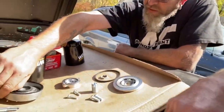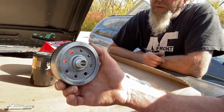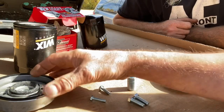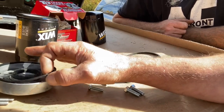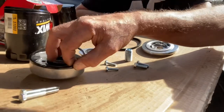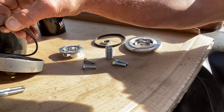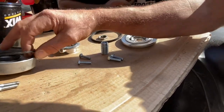As I showed you in the last video, this is the unit we got first - the one that failed. What was going on is this is like some kind of fabric or foam that was actually pushed out. Last time I took it off it was under pressure and it kicked this to the outside. I had actually glued it on to hold it in place - the glue used was pretty wicked. Those are two seriously weak points. We were having an oil pressure issue where we had 40 pounds when we started cold and all of a sudden it would go away. We're hoping that this was the problem.